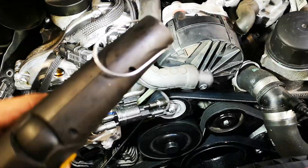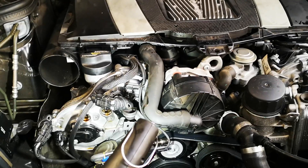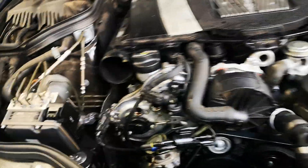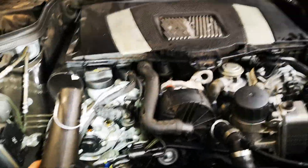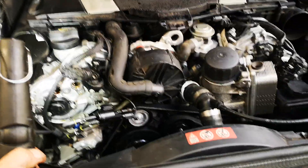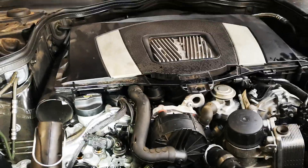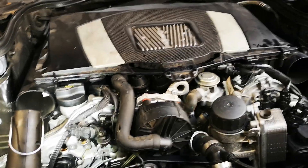This information I'm going to simplify greatly. You get a P0017, which depending on your interpretation through my scanner, it'll tell me that it's a variable valve timing retard, permanent retard state. But the generic thing would be camshaft correlation type code. And we have this over and over with these cars. One in ten will be an actual camshaft sensor, and the rest will be a timing chain. Here, apparently, it's a balance shaft fault.